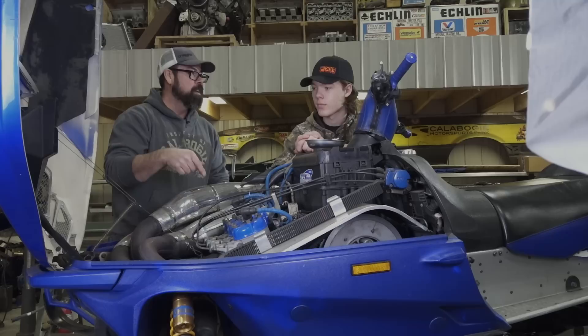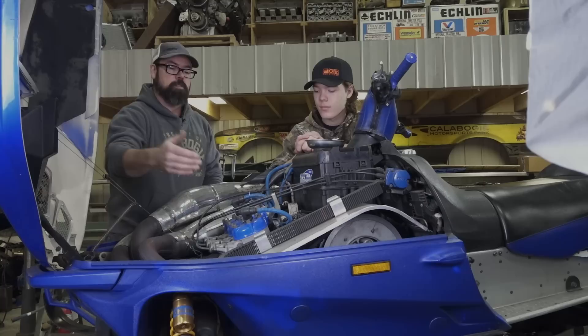This Yamaha tip is also a teachable moment all about naming your snowmobile's cylinders — and they're not Tom, Dick, and Harry. Whenever somebody's referring to the engine cylinder of a snowmobile, it's either the PTO, middle, or mag side cylinders. PTO stands for power takeoff — that's always the side your power is coming from, so it's the clutch side. Then you've got your middle cylinder, and then your mag side cylinder, which is the side your ignition's on, so the magneto's in there. If you have a twin, the middle cylinder isn't there — so you just have PTO and mag side.